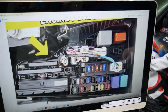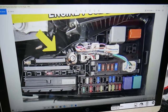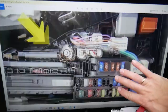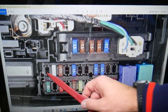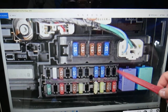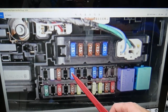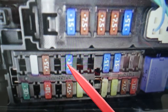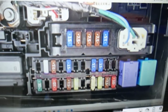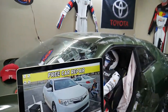For the left and right turn signals, there is one fuse only. Let me zoom in — looking at that row of fuses, even if you have a missing fuse, count the spots starting from this side: 18, 19, 20, 21, 22. Fuse number 22 is the one you need to check for the turn signals. Hopefully the video was helpful — if you have any questions, let us know. Thanks for watching, see you next time.